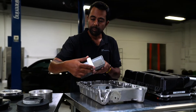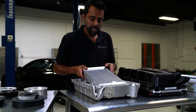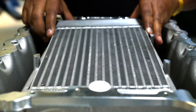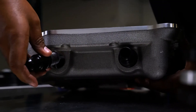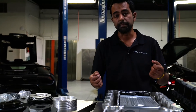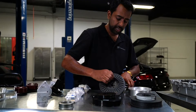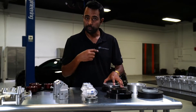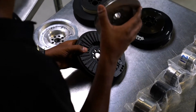There's a PTFE rod you'll see here which allows a free-floating concept to exist with this heat exchanger. The heat exchanger supports the entire core inside, and the manifold will all sit together as the entire piece heats up and cools down during cooling cycles. The next step was to create a supercharger drive system — the actual belt system to drive the supercharger — and that was all based around the factory crank pulley. The factory crank pulley has five ribs, and in order to create optimal drive and traction for the supercharger we would need additional ribs. We created a couple of different prototype bolt-on pulleys, also to drive the alternator.